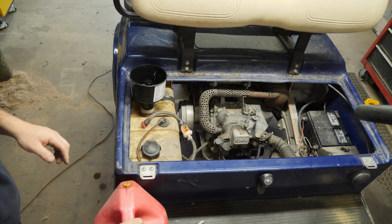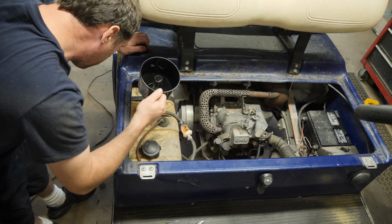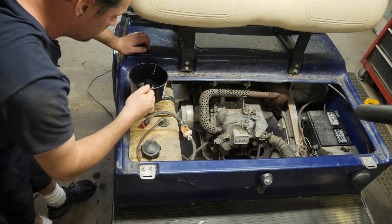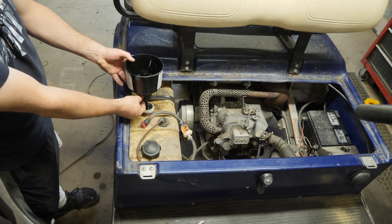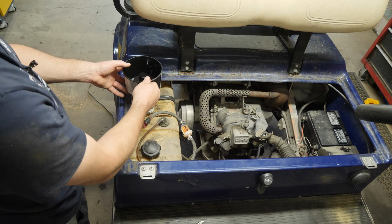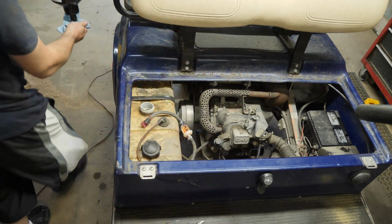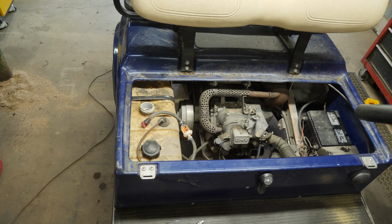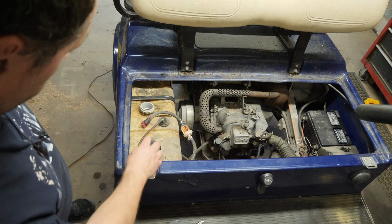Okay, that is 99.999% of the gas in that can. Make sure that's all in there. Yep, full tank of gas. Now these Mr. Funnels, there's a little reservoir here that captures any water or chunkies that might be in your gas can, so just be forewarned of that. I like to dump it in the oil waste pan here. I'd rather waste an ounce or two of fuel knowing that there's no water in my gas.